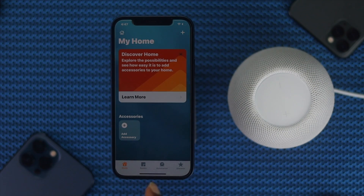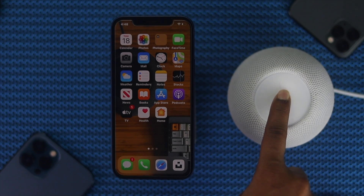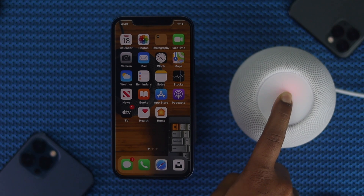Afterward, you will see that your HomePod is no longer connecting with your iPhone. Even after that, you can use your HomePod itself to do a factory reset. To do that, make sure to unplug it for around five seconds, then plug it back on. Go ahead and place your finger in the middle and keep holding it until you hear Siri start speaking — your HomePod is about to reset. Keep pressing until you hear three beeps.